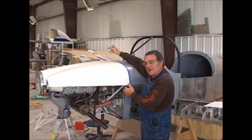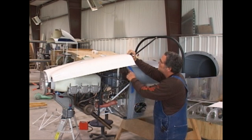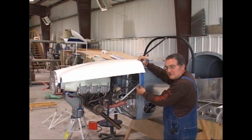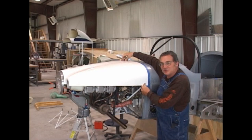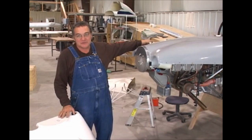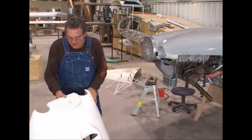Once you've got that rear edge of the cowling trimmed off, you go ahead and establish the locations for whatever fasteners you're going to use. In this case we use quarter-turn fasteners, and you'll drill your hole in the fiberglass to match these fasteners. We've already got them attached to the flange that mounts the cowling and attach this into position where it's eventually going to go. To do the lower cowling, once we've got the upper cowling in position and established the fastener locations along the trailing edge, it's time to get on with this one.